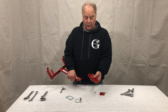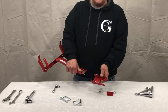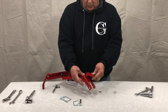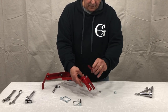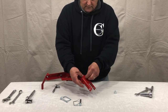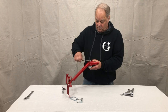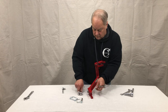For most users, you're going to use your ball mounting base. This will allow you to hook up to either an inch and seven-eighths or a two-inch ball — it just simply drops through like that. The support stiffener and washer go on facing it; the hole is a little off-center and will point towards the front of the bracket. Add the lock washer and get it tight.